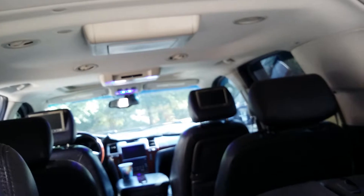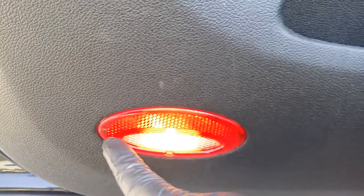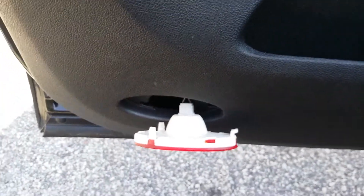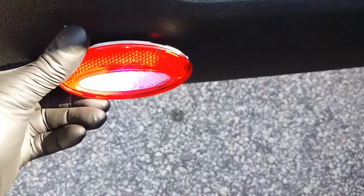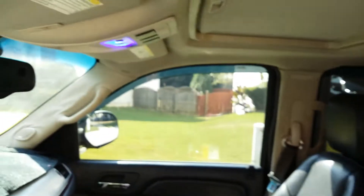New bulb is in, lens back up. Now we're doing the doors. You can just pry from the sides or the bottom, but the sides are better because the hooks are on the sides. We have our lens out now — just pull the lens forward, bulb comes out. I just popped out the old bulb and installed the new one. The old bulb has two prongs. You just take this hook, push it in that hole, and that covers the whole interior of the Escalade. Thanks for watching — subscribe, comment, hit that like button, see you next time!